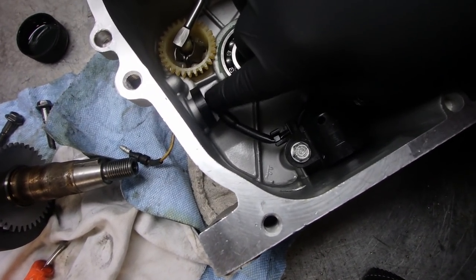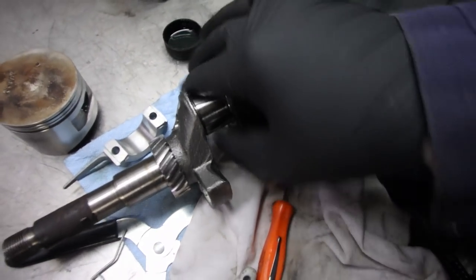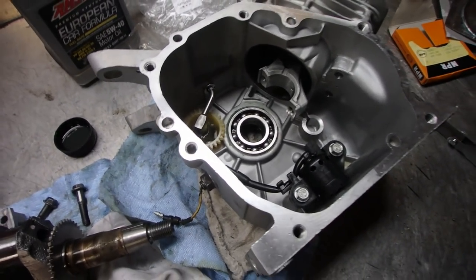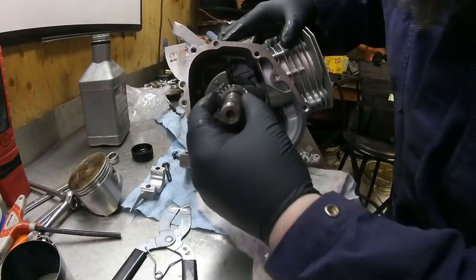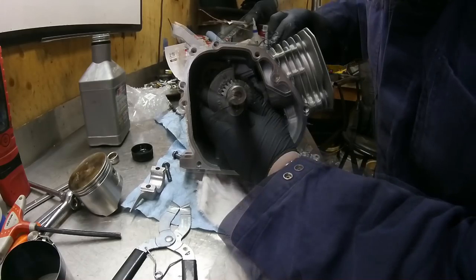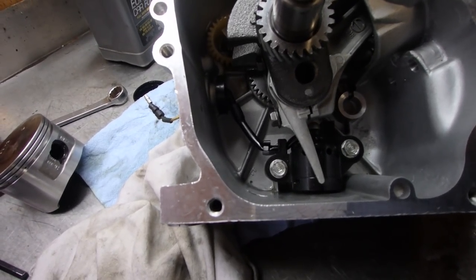Give it a little tap to seat it. Now put the crank back in. This is also a good time to put the oil level sensor in — getting the sender in is pretty simple, just make sure the O-rings are on. Two bolts to secure it. Put some oil on the shaft and slide the crankshaft in past the connecting rod. Connect it up and do those bolts up for the connecting rod — that part will be finished.